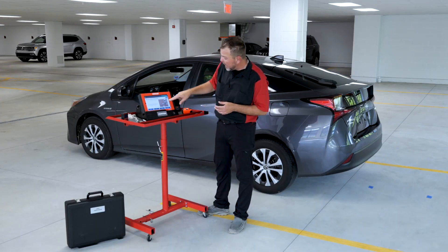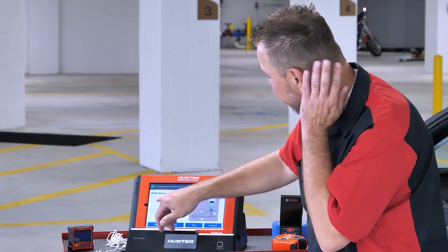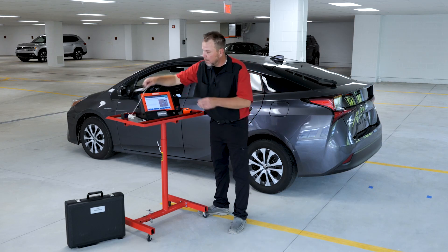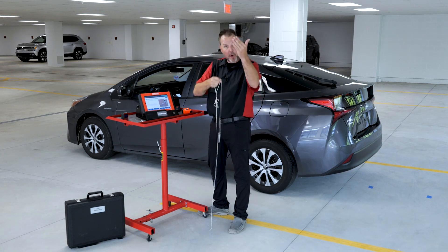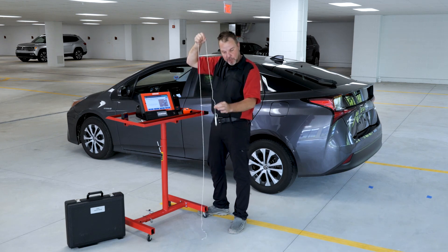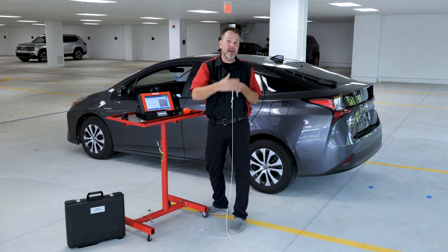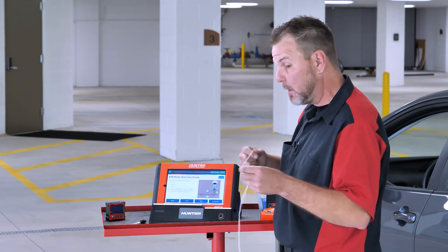What we're going to do now is set up the actual dimensions we need for this — the radar stand measurement setup. Your X, Y, and W are what we're going to measure right now. But the first thing I've got to do is get a center line on the vehicle. The center line — what we're going to use is our plumb bob. We're going to mark using the Toyota emblems, front and back of the car, directly in the center of the emblem is where you're going to put your mark on the floor. Then we'll run a chalk line from front to back. I'm going to get my center line real quick.